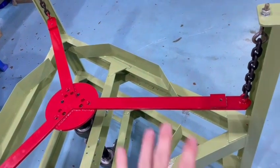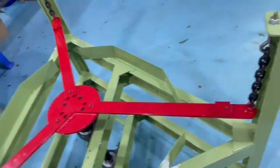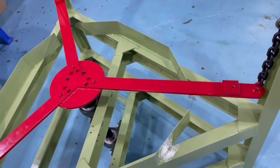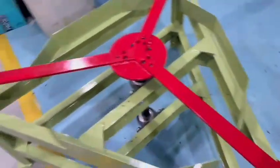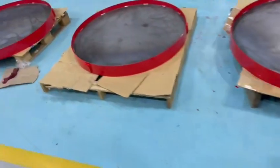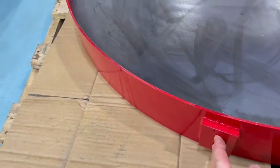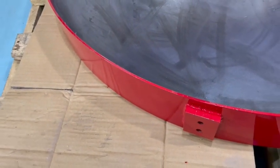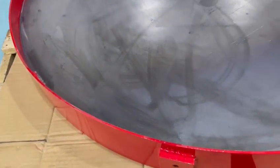What that's telling you is that the whole pan is shifting back and forth a very small amount — might only be a sixteenth of an inch or even a thirty-second — but that movement is too much. So if you hear a squeaking and it's got excess vibration, first thing to check is check the bolt here. Then if we look at the main pan, because it's two-sided, it's got two bolt holes — check the bolt that's going into that. That's the core things that are key in keeping your machine balanced and running smooth.